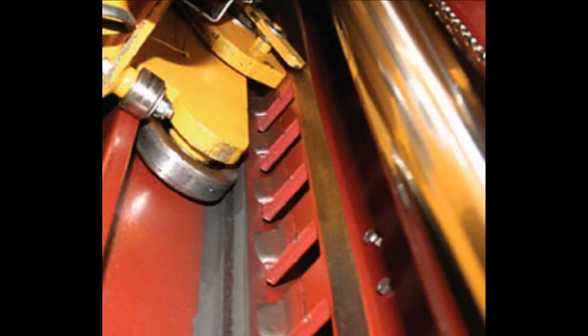With the lifts, you have to deal with safety issues. They could break when the car is up in the air. I've had that happen one time over the years — it was an incident where one of the cables overhead broke. But you do have safety latches that are like every six or twelve inches — it'll have a safety catch. So when a cable does break, the car won't drop completely off the lift, it just drops a couple of inches.